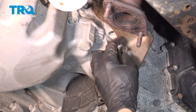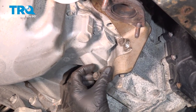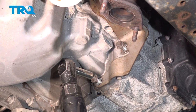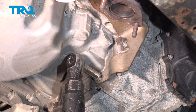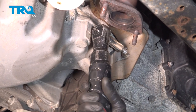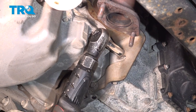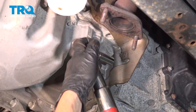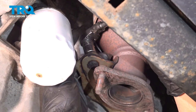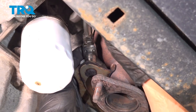Let's start installing the two bolts for the catalytic converter pipe. Snug these up and torque them to 52 foot-pounds. Then continue along the top of the bracket and tighten those two 13mm mounting nuts.